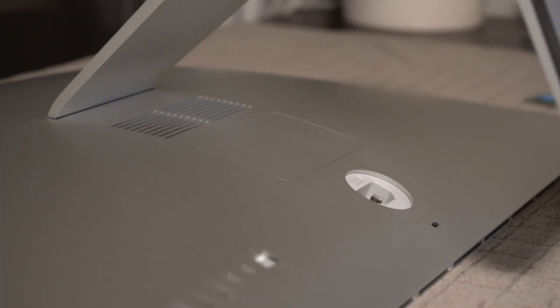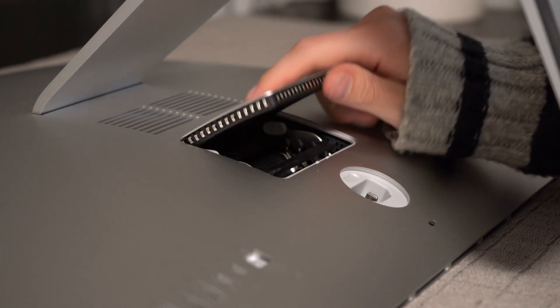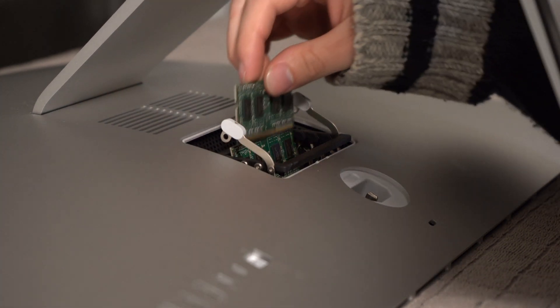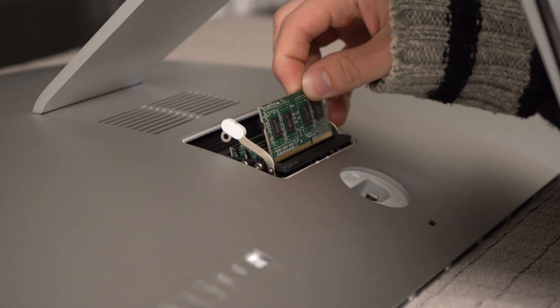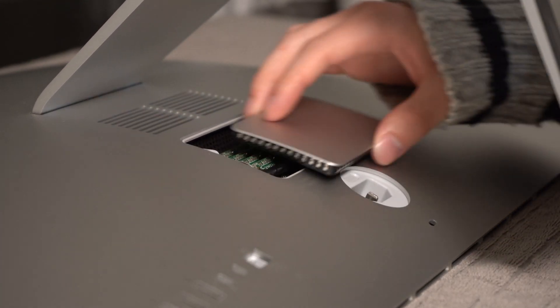Changing the RAM is actually pretty easy. Start by unplugging your iMac, and after removing the plug, you'll see a small button on the inside of the port. Press that down with a screwdriver or something small and it will pop open the RAM compartment. You'll pinch two pins on either side and the tray will open. Simply put in your RAM and then push the tray back into place. Put the door back on by pushing it into place, and that's it. Once you log back into your Mac, hit the Apple icon, go to About This Mac, and under the memory tab you'll see all your RAM slots and how much each one holds.